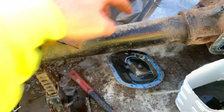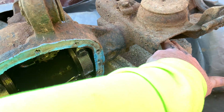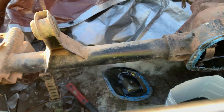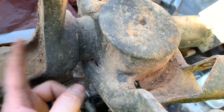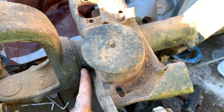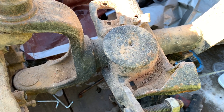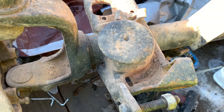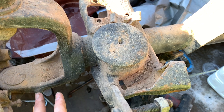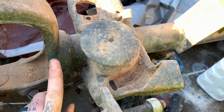The first thing we have to do is drill a hole here, here on the back side, and here on the back side. Then the short tube — I've got to drill a hole here and on the back side, and this just slides through. But before we do this sliding through, I'm actually cutting these off and rotating them back so I can get better caster and a better pinion angle. I already did all the measurements I needed to do to have the perfect pinion angle. Now I've got to do the measurements to get my caster angle.